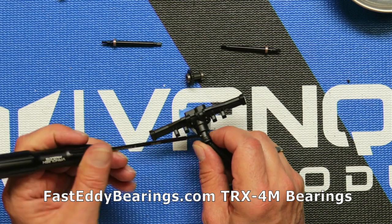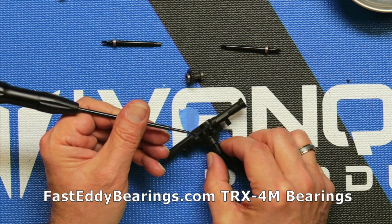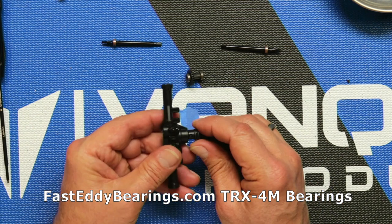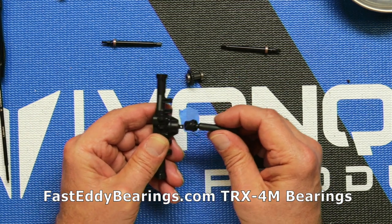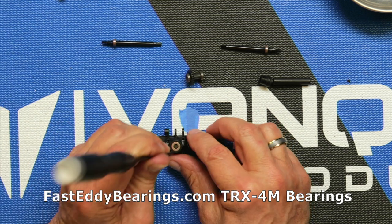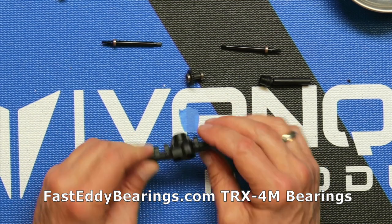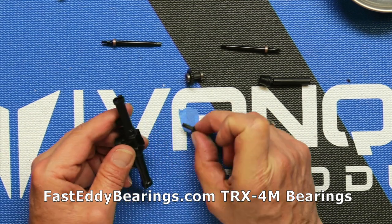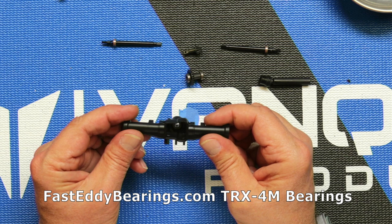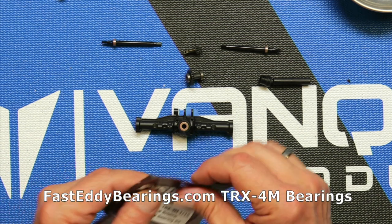Okay, well on mine it is just a little screw, however it is stripped. When it was put in originally, I think they put it in a little too tight and it wasn't grabbing any thread. Now that that's out, we're going to pull off the drive shaft and set it aside. We'll use our driver to push out the pinion gear, and now we can see there are two bushings in there for us to replace. We have the entire diff apart.